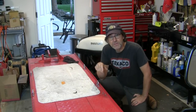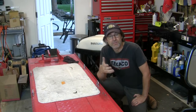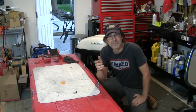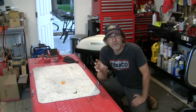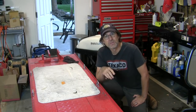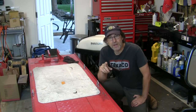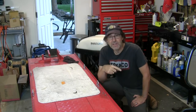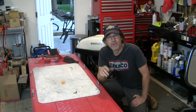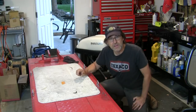The approach I'm hoping to take — if any of you have watched the video of me taking the engine out of the frame, go ahead and watch that. I recently rewatched it just to give me an idea of how this is going to go back together. Video and photographs are such a great record and make a good service manual when putting things back together. I wrestled that engine out and it's heavy. Now I've painted it and I'm going to ding it up if I put it back the same way, and I don't have the benefit of the center stand anymore because I've removed it. So we're going to do the lay-the-engine-down-on-its-side trick and put the frame down on the engine — that's the plan.